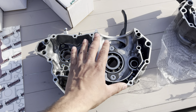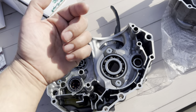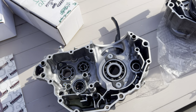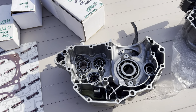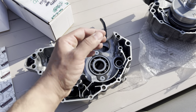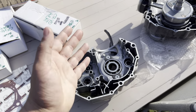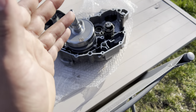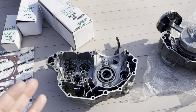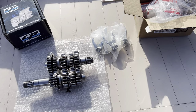After this video I'm going to get some brake clean and get these cases cleaned up — I might even paint them. For bearing removal, I usually just heat up the bore a little with a torch and they pop straight out. For assembly, put the bearings in the freezer, heat up the bore, and you've got to move fast — the bearings should just fall in. Do not beat on these with a hammer. This isn't a house and you aren't Bob the Builder — do not beat on the cases with a hammer or you'll have a bad day.